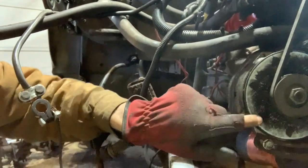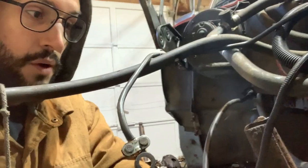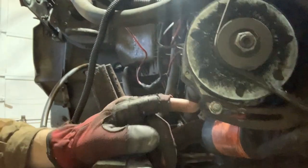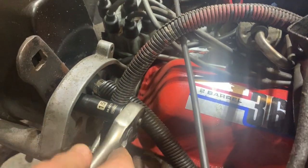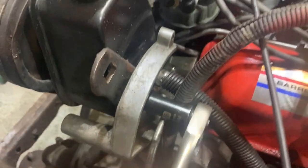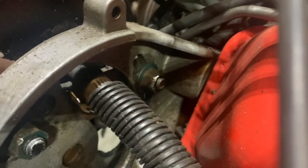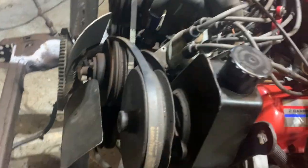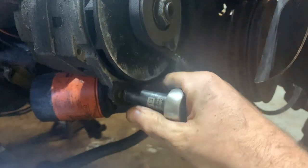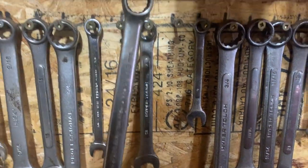For the second belt we have to look all the way over here to where the alternator is. You can tell right away that all this stuff on the cover was one of the old belts. However, the same principles with that power steering apply down here — there's this bolt and all I need to do is loosen it, and you can even see the track as you go back and forth to loosen and tighten the belt. I'm using a 15-millimeter wrench — all it requires is just a decent little turn. There's actually a second one that holds it in place as well. Now it's loose; we can just take this whole reservoir and push it out of the way. Pretty loose, ready to come off. This side is the same thing but now we're just using the 13.